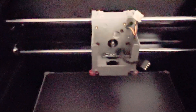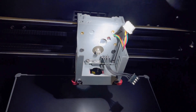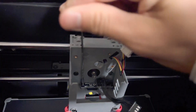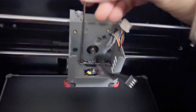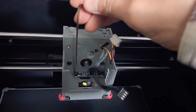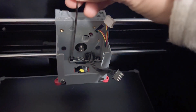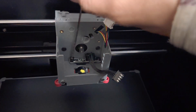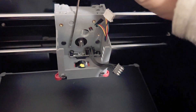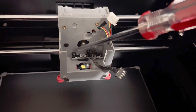Now we're at the point of actually replacing the cable and the interface card — the print head bus cable. This is still the two millimeter Allen key. Remember: righty-tighty, lefty-loosey when you undo screws — that's standard for everything. Turn left or counterclockwise to loosen, right or clockwise to tighten. I'm going to get my magnetic screwdriver and pull that out.